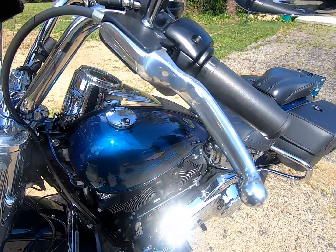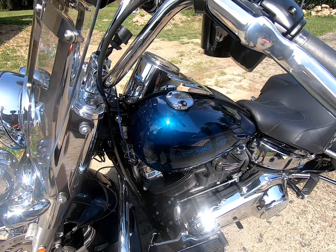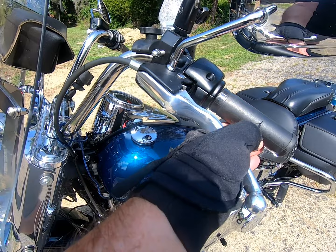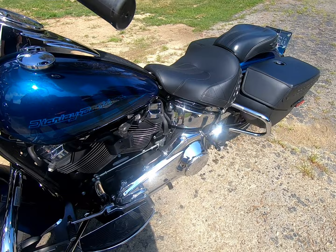The reason is this got repaired from an accident — they replaced the frame and put all this stuff back in a new frame. I got hit by a car in March of 2022. When I got it back, this clutch handle comes almost all the way out before it starts to engage, so there's like no free play. I want it to catch closer in so my hand is not totally open. We're going to start by checking the slack of the cable adjustment first, but I'm pretty sure I'm going to go into the primary and physically adjust the clutch anyway.